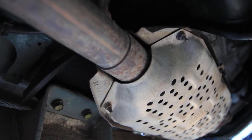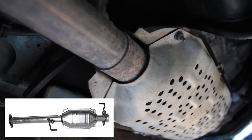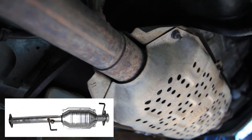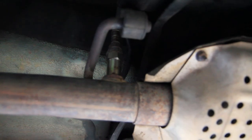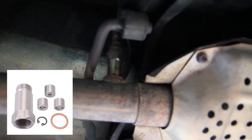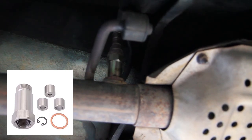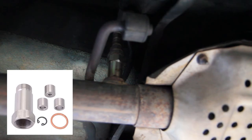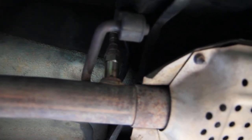I tried to fix this the right way — I bought a new cat — but the replacement part didn't fit correctly and I couldn't locate the required gaskets to make it work. I read that people had success with O2 sensor defoulers. I bought the one shown in the inlay, mounted on the second O2 sensor just after the cat. The part number is in the description. It comes with a range of port sizes; I used the medium one. After adding the defouler to the second O2 sensor, the P0420 code was solved permanently.